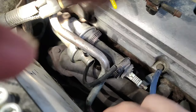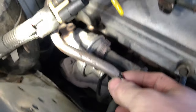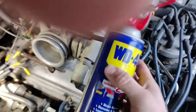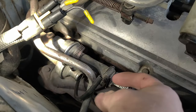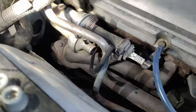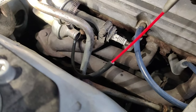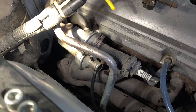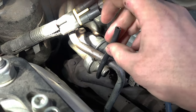I got this back spark plug out on the passenger side, but I could not for the life of me get the can of WD-40 and the hose into the cylinder hole. So what I did — a little trick — is I took this rubber hose and just slid it down into where the spark plug would go. I'll take the straw. You don't need a lot — I don't want to waterlock the motor — but that'll all flow down into the cylinder and we'll be good.